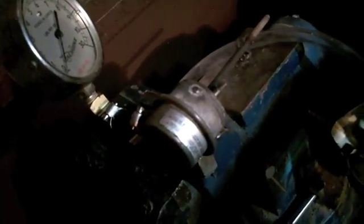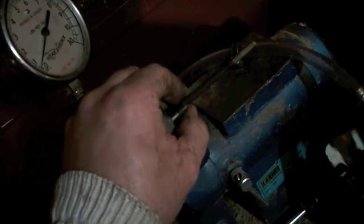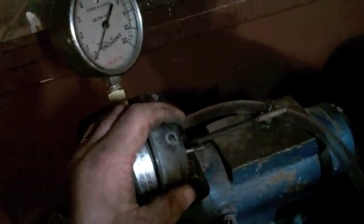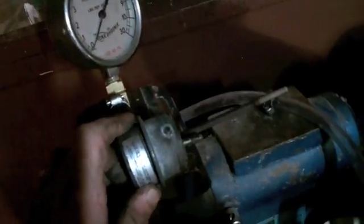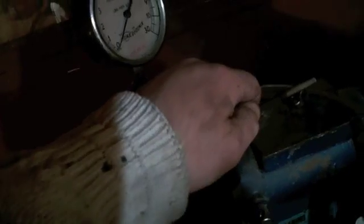Let's see what it does. Much better. So now it's fully actuated by 7 psi, pulling back in, and we start to actuate at 2 psi. So it dropped a pound and a half. We went from being fully actuated at 9 psi to being fully actuated at 6, 6 and a half. And we went from starting at 3.5–4 to starting at 2, 2 and a half. Those are the numbers I'm really looking for.